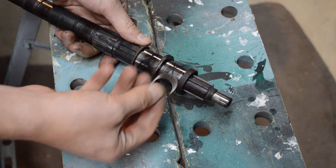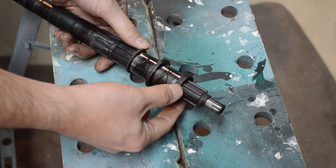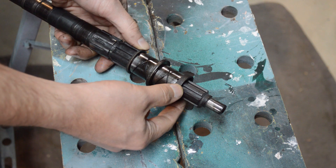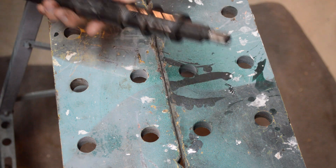I'm not going to do this right now because the circlip is a pain to take back off, and I'm changing main shafts anyway. So if you're going to change the main shaft, you should probably check the end float on the new one. That's what I will be doing when I start ordering parts — but now I know what I need.